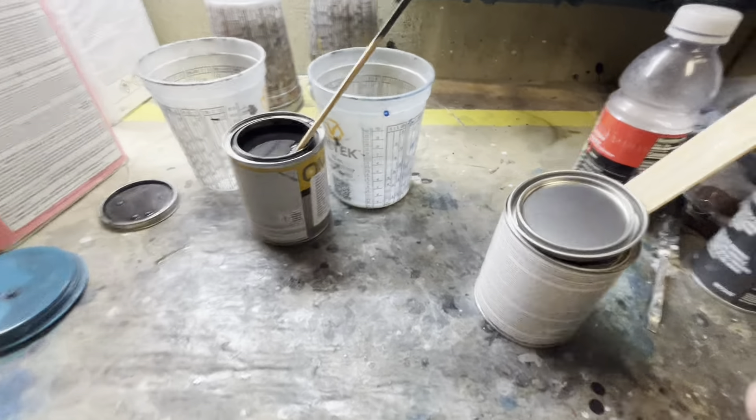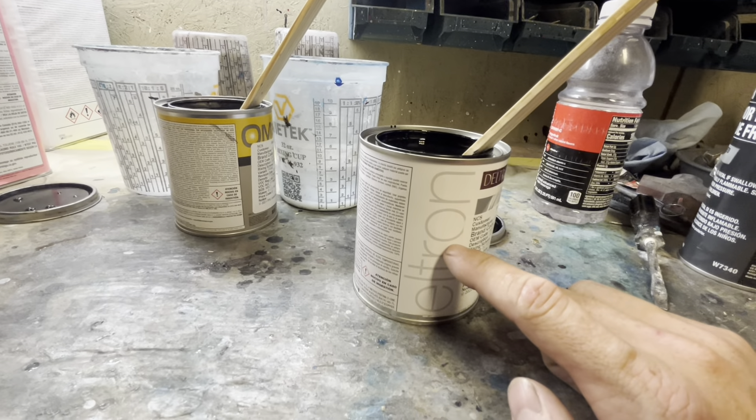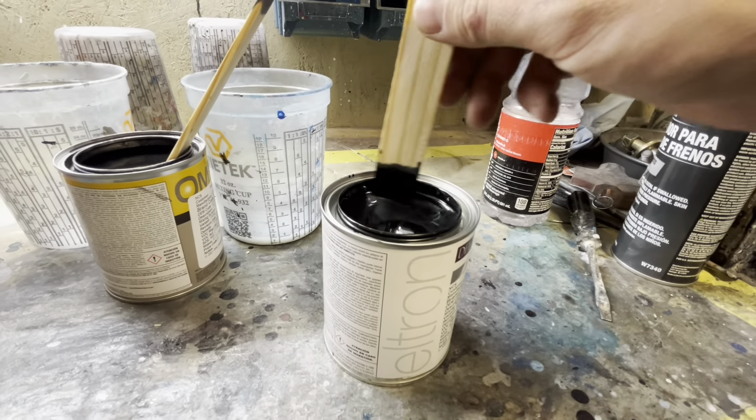When I say I'm going to stretch it, I mean I'm going to get some scrap paint and mix together some scraps, or find a scrap as close as possible to the color I purchased. I'll lay that down first so I already have that foundation color, and then go back over top of it with my actual color. This is our Deltron — the paint store gave me half a pint, it mixes one to one, so I reduced it to a full pint. That half pint was $85 in Deltron. You can't make good money on flip cars paying $85 for half a pint.